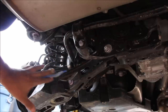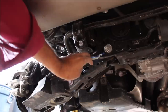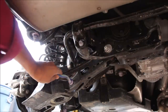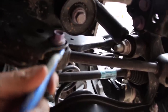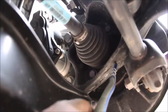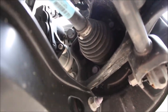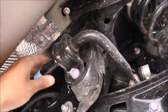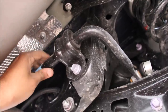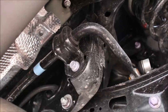Here's a good look at that multi-link suspension system from underneath — at the lower control arm we have a camber adjustment and here's the bolt for the stabilizer link. Surprisingly on the front lower control arm there's actually no toe adjustment. From in behind the suspension we have a steel knuckle with a bolt-on style hub, which means you don't need to use a press to change bearings. Here is where the front trailing arm bolts to the body as it leads down to the knuckle. At the back the sway bar is actually pretty small and could use some easy upgrading — just two bolts and the sway bar link and it comes right off.